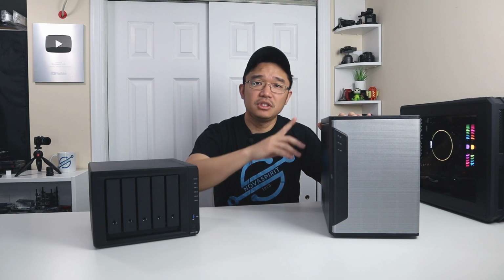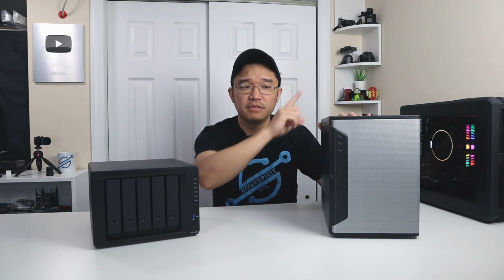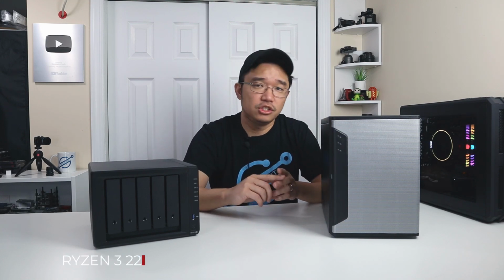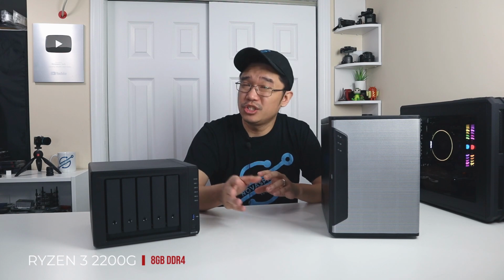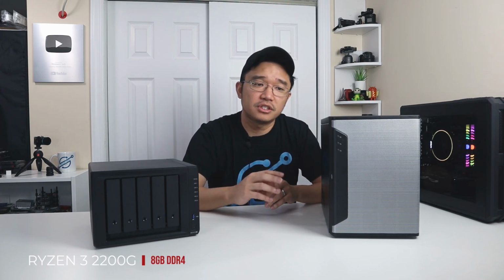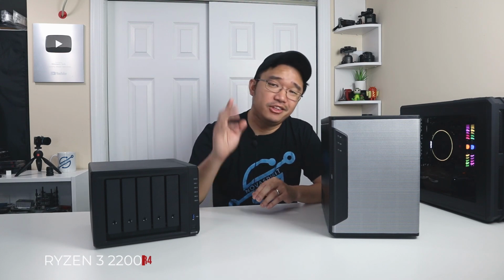If you haven't seen this guy, I will leave a link to this video up on the top left corner, but I'm gonna give you guys a quick rundown in specs on the one that I built. So I built this with a Ryzen 3 2nd generation with the graphic card built in. So it's a 2200G and it's base clocked at 3.5 gigahertz at 4 cores. It also has 8 gigs of RAM, but at DDR4.